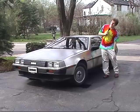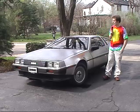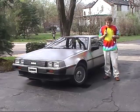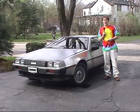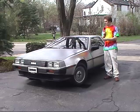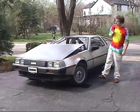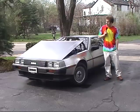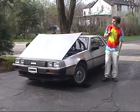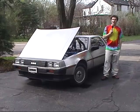Today I'm going to be demonstrating linear actuation of the bonnet. Other DeLorean owners who have Toby Peterson's trunk-a-loft kit should recognize this, which will unlock my bonnet. However, I've installed a linear actuator system that does more than just unlatch the bonnet — it actually raises it to a fully open position. This is using an Auto-Lock LA-8 linear actuator, and it's got a custom fabricated bracket that pushes the bonnet to a fully open position with 8 inches of actuation.